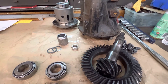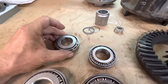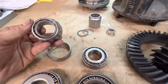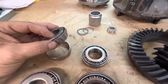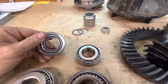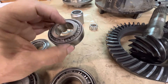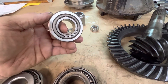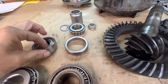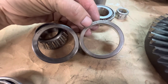This is the original factory bearing — it's a Koyo bearing. This is your outer pinion bearing; there are 16 rollers here and the pitch angle is correct, of course, because it was designed for this Honda differential. This here is an aftermarket Timken bearing — it has differences in roller count and dimensions.